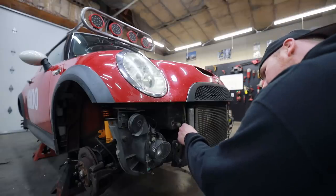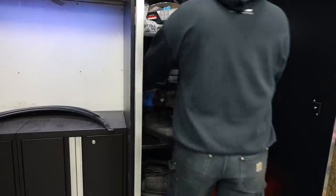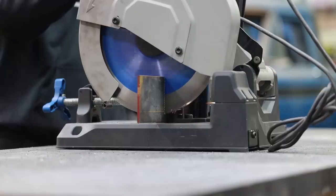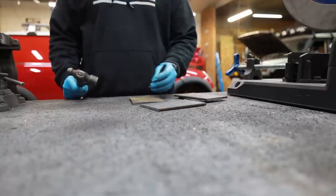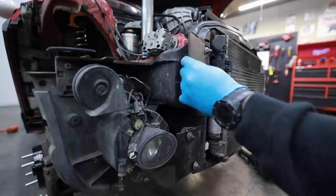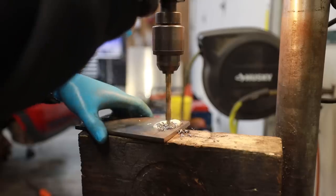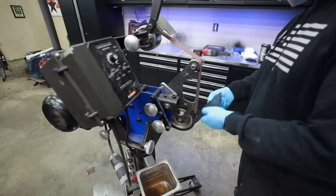The lift went on super fast because it's literally just a set of spacers that bolt on top of your struts, or in our case a set of coilovers. As Franz finished up that work, I got started on the front bumper. I made a couple of plates and decided where the bumper needs to mount. I'm building these mounts out of 3/16 steel to make sure the mounting surface is nice and rigid, giving us a solid foundation for the rest of the tube work.